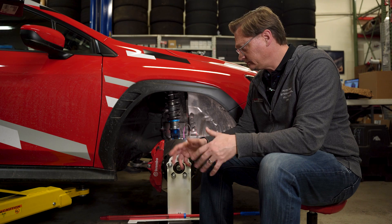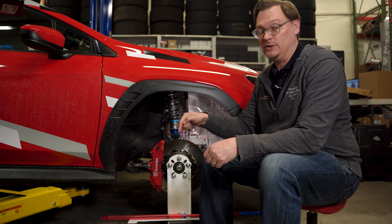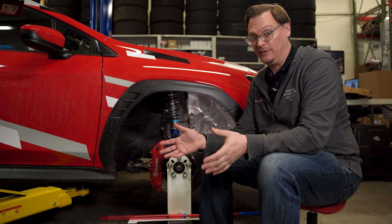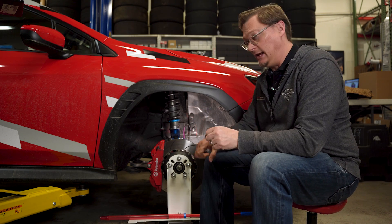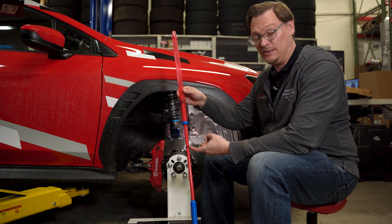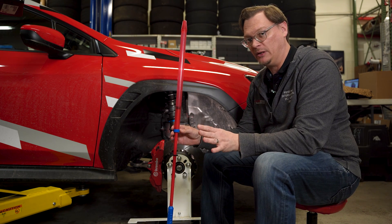When you get the car on the ground, look at the ride height — we went up an inch, which is what we wanted. If you wanted to lower the car an inch you'd have to lower the ride height two inches to get it where you want in terms of travel. We have 100 millimeters of travel, which is a lot. There are a lot of coilovers out there where the whole amount of travel the coilover has is 100 millimeters — if we had 100 millimeters of travel in our strut and 100 millimeters of droop, we'd be on the bump stops. But these struts actually have 185 millimeters of total travel.